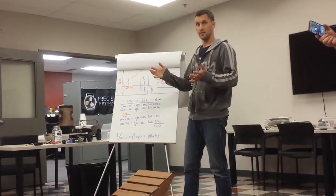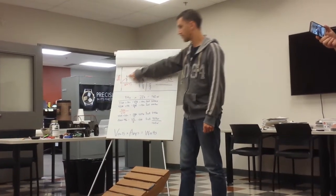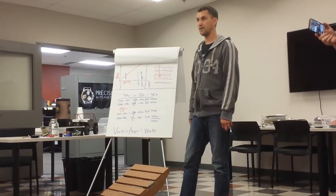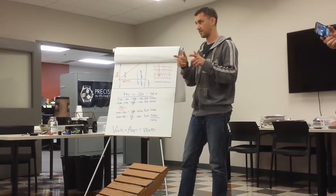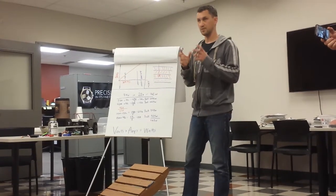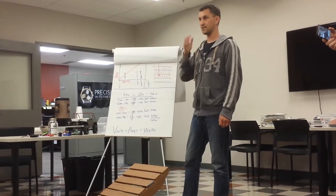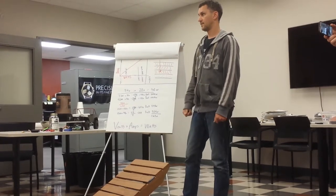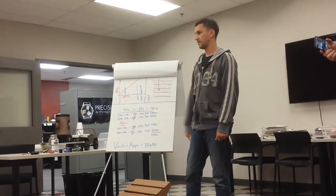If you have a boat, you need a lot of available wattage because the drag never changes on the boat, ever. If you're running fifth scale and it has a huge peak current, the peak current can be braking or power, which is why a lot of guys with big trucks or big ESCs, big batteries, turn the brakes down. If you can, turn the brakes way down because the flash current on braking is actually worse than the pickup current on throttle. You can create more damage and more fire and more electron heat with braking than you can with acceleration.